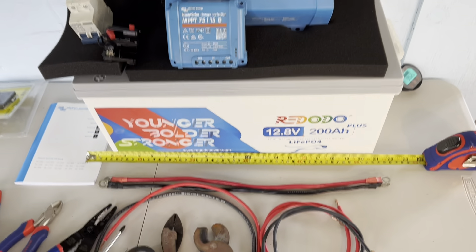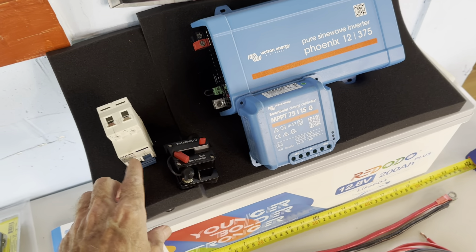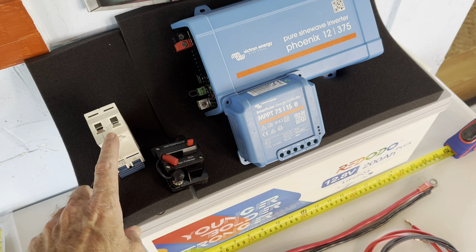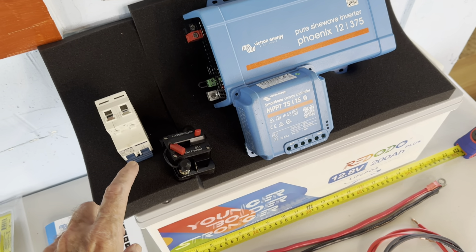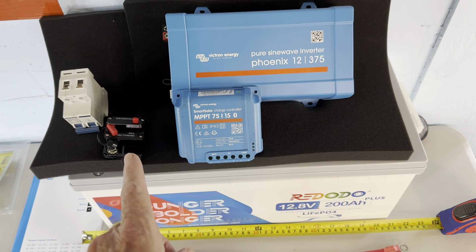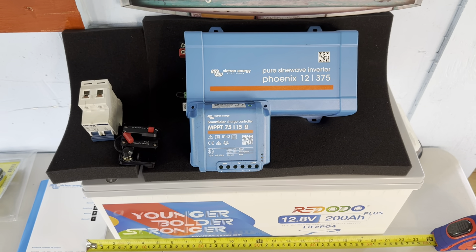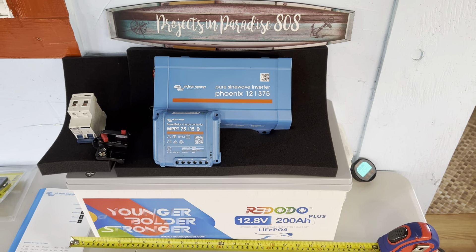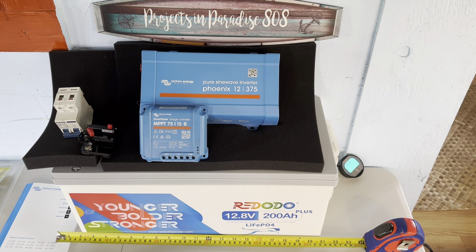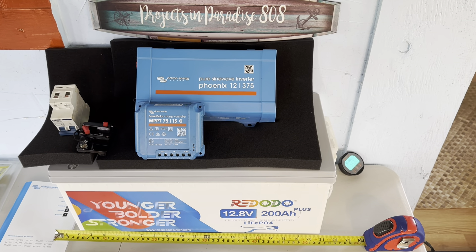Right now I'm going to pre-cut all my wires. I've got this solar isolator switch here, a ten-gauge wire coming in from 200 watts of solar, and I just need ten-gauge to go from there to the charge controller as well. I'm going to put a 50-amp fuse — actually a 50-amp breaker — between the inverter and the battery. It's going to be a very simple build, but I like to lay it out and get everything pre-cut before I crawl into the rather small cramped quarters where this is going to go.